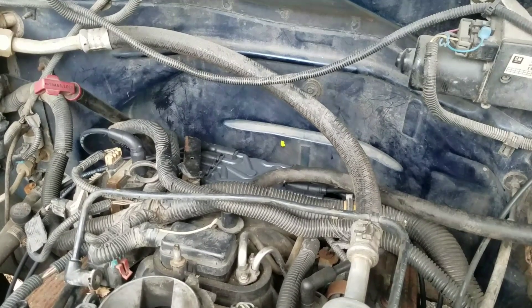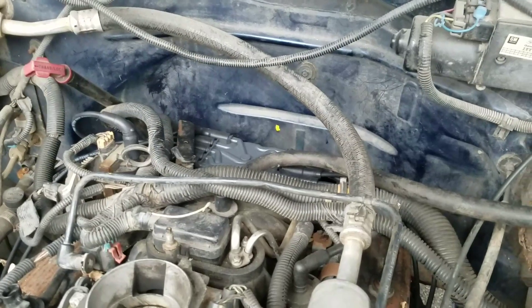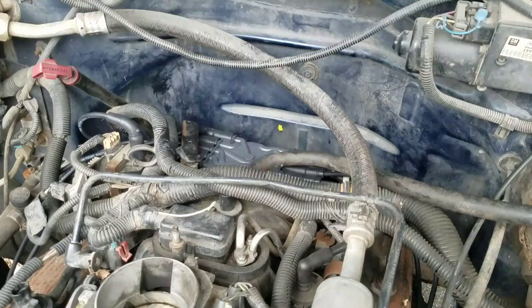To compensate for a positive reading, you're going to want to turn the distributor clockwise. And then of course pulling it will be the opposite for the rotor. So I pulled it and advanced it a tooth.